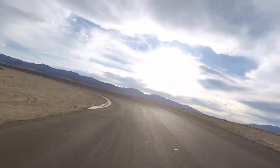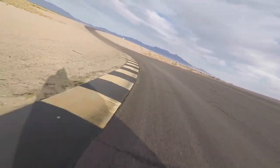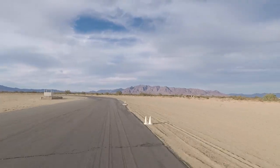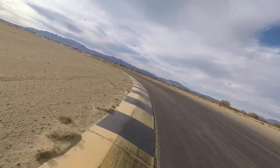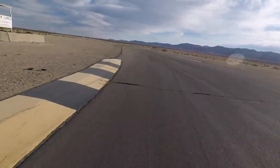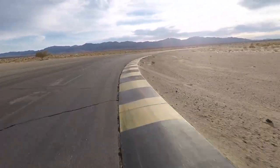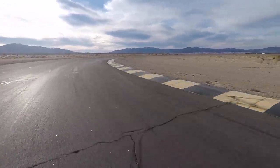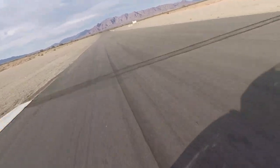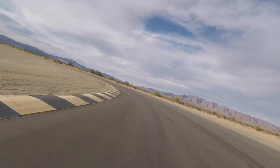And the bowl with it under a little more duress. There's some sharp bumps about halfway. Those definitely feel softer in the back. Okay, a lot of ripple bumps in the front. Not too much difference with how the back of the bike feels through those ripples. But that's a steady state corner, slower speed. A lot of ripples in this corner, and the back and the front feel the same. So it seems like speed introduces more smoothness when there's obviously more duress on the swing arm.